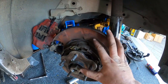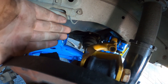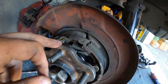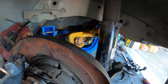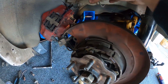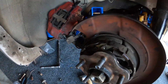I've got the rear hub on, the rear camber arm in, the bottom of the coilover onto the knuckle, the rear ball joint on with the nut done up and split pin in, and the CV shaft is done — I'll put the bolts in once the other side is on and I can put it in gear. Now I'm going to get the rear track arm sorted out. I need to copy the adjustment measurement from the old ones to the new ones that are in the box.